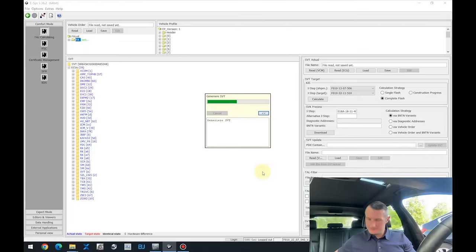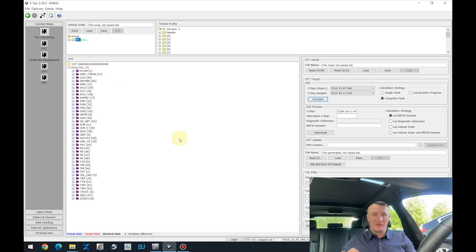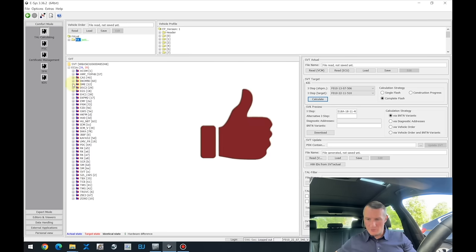Why am I updating the engine ECU? Because BMW has released several bug fixes for the EGR. This is exhaust gas recirculation. And if you do not make the update and just delete the AdBlue system on the older software, your EGR will not work properly. That's why there is just no point. Also, if you're making, for example, chip tuning, always update the software before making the chip tuning, because if you chip tune it first and update the software afterwards, you will just lose your chip tuning. That's why there is no point in that.